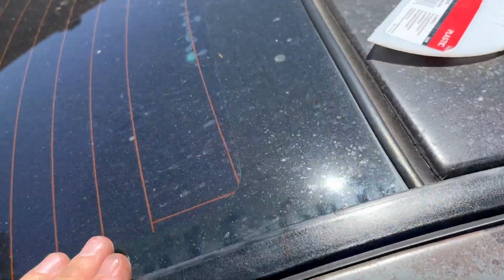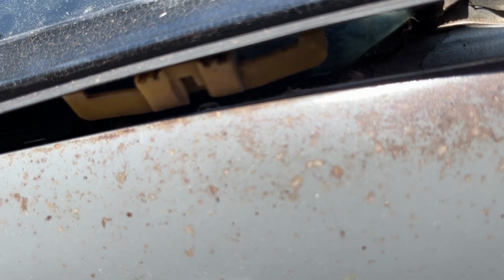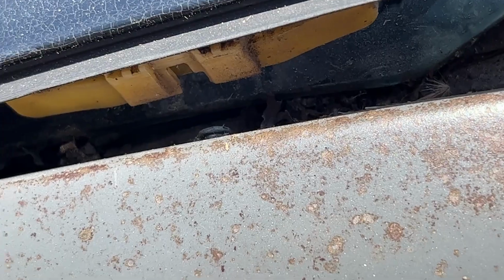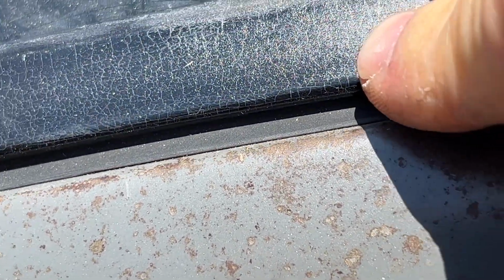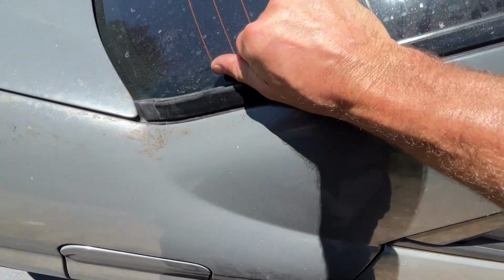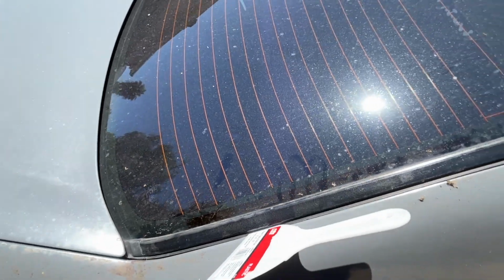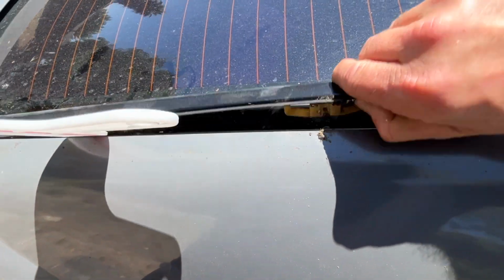Once you get down to this back window area, they're a little bit different. They just directly push down. Got a little nub in there, and then we got this little plastic piece. So it's basically keeping it stationary. Just be careful with it. If I could do it with one hand here without wrecking it. Probably not, but yeah, that's pretty much the basic rundown on how to get this roof rail off. Just like that. And that's that.